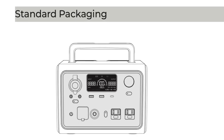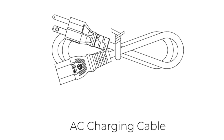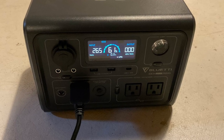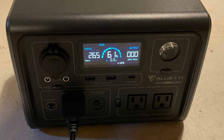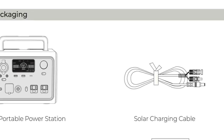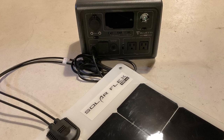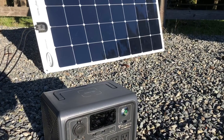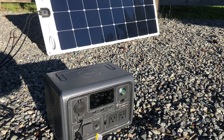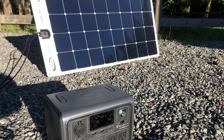When the EB3A runs low on juice, there are six ways to charge it up. The easiest way is to use the included AC power cord and an AC outlet with the built-in 268-watt charger, which will take you from 10 to 90 percent charge in about an hour. Here we're charging at 265 watts and the display tells us it will take another third of an hour — about 20 minutes — to fully charge from 61 percent. Like all batteries, the charge rate slows as the battery fills. The EB3A also comes with a solar charging cable, which allows you to use the built-in solar charge controller with up to 200 watts of solar input. We had a rare glimpse of winter sunshine that enabled me to test the solar charging capabilities, and here I'm getting 70 watts of input from a 100-watt panel with the sun low on the horizon. The best I've ever gotten out of this panel on my AC50S is 85 watts in the middle of summer, so I consider this to be pretty good.